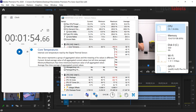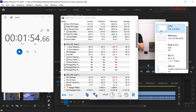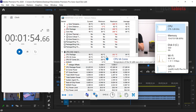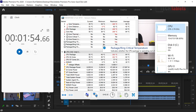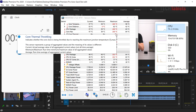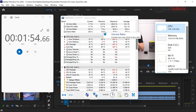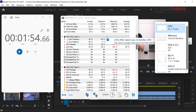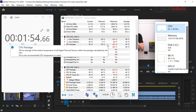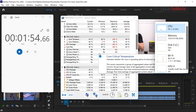During the export, all four cores dropped down to around 2.3–2.4GHz due to thermal throttling. The Iris Plus 655 and CPU were both working together on the export. Temperatures peaked at 100–101 degrees Celsius, which is not great to see. This only happens under very strenuous workloads like exporting video or running Cinebench benchmarks. The fan noise isn't super loud; perhaps pushing the fan harder could help lower those peak temperatures for this 28-watt part in such a tiny chassis.